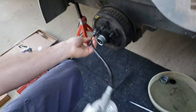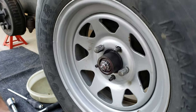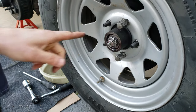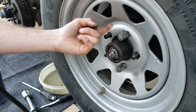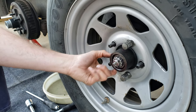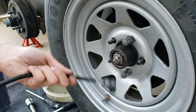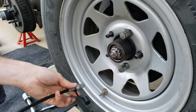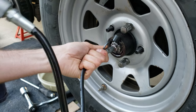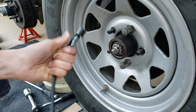The last step: you saw I put grease on the spindle in the middle. The reason is when you pack more grease in with a grease gun — because these are greasables — you're putting the grease through the back of the spindle and it comes out a hole in the very back of the bearing. As you pump it, the grease goes through the back and works its way to the front, so the old grease comes to the front. By leaving no grease in the middle, when you go to pump it you're just filling a void. So might as well put some stuff in the void initially, just like the back seal I filled up. And now I'm just doing a little more — pumping it about ten times — just to fill that void a little more so as the grease comes out of the bearing slowly, the other grease is there pushing into it.